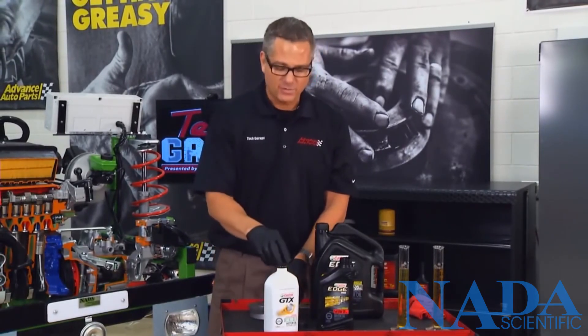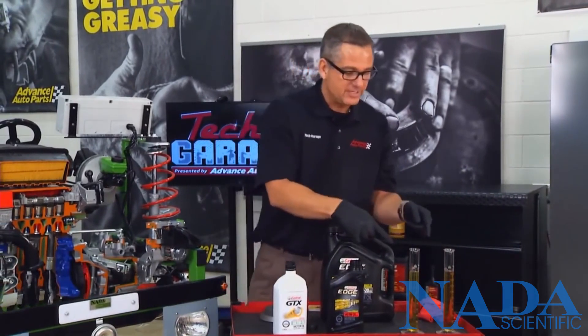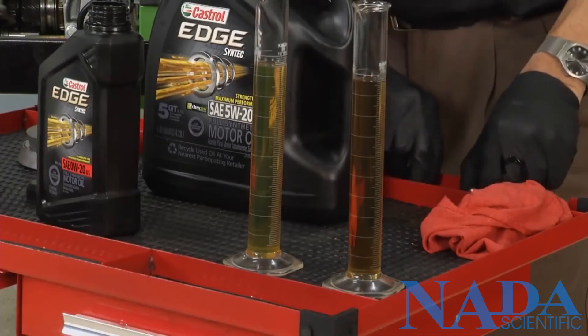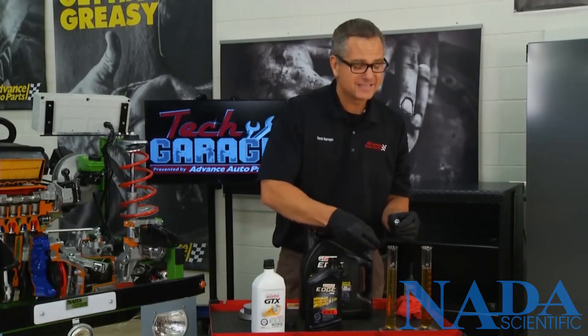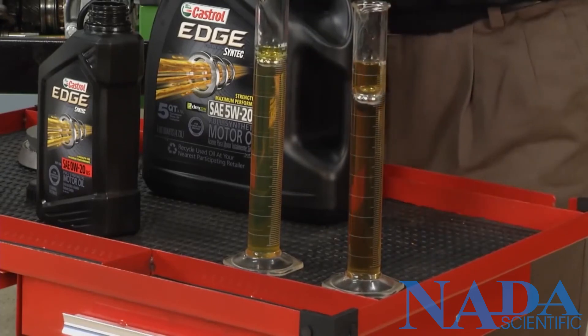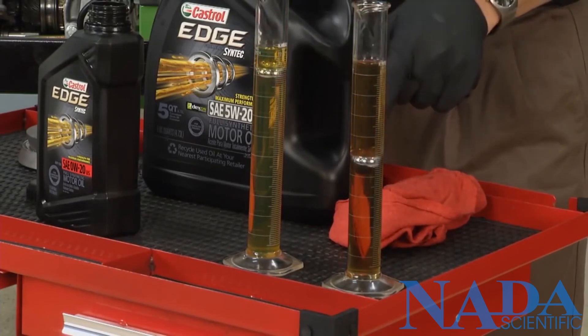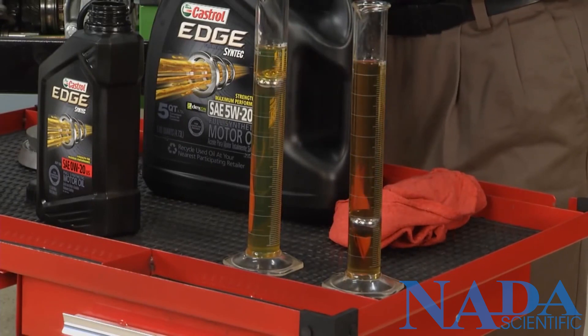There are also viscosity ratings of oil. You need to check your manufacturer's service manual for the right viscosity for your vehicle. Viscosity is basically the thickness of the oil — the ability for it to flow. I have a demonstration right here: I have some 80-weight oil and some 5W-30. If I take these balls and drop them in the beaker, you're going to see that the 80-weight is not going to travel very fast, while the 5W-30 is going to go real fast. The 80-weight is barely getting through because the oil is thicker; the 5W-30 goes right down. That's why it's so important to consult your owner's manual for the oil you're using.